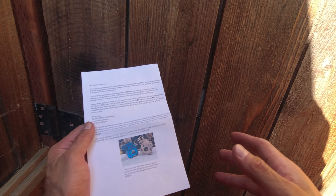You can read it here: 2019 and earlier M8 motorcycles — there is no seal between the oil pump body and the crankcase inside the cam chest. Harley incorporated the seal in 2019. My 2020 model is fine. This seal prevents pressure from the crankcase pushing into the cam chest through the pinion bearing. Please check with your dealer to see if your bike has had a replacement seal, backing plate kit, or new oil pump installed. If not, 2017–2019 M8 owners may risk pushing excessive oil out the M8 vent system.